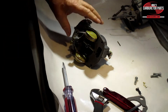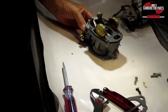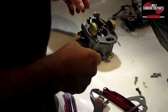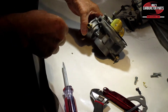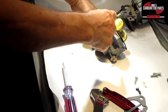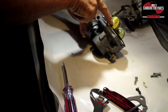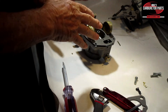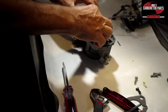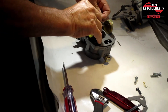I'm doing this rebuild video and I realized when I was editing it I didn't spend enough time on adjusting the float, so I'm going to go back and insert this into it. The float level is measured from here to here — take your measurement tool and go from here to the top of the float. Do not adjust the float by bending the pontoons, and don't adjust it in here; if you put any pressure on that needle it's going to flood.